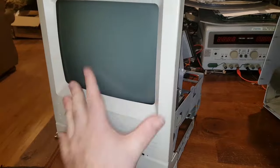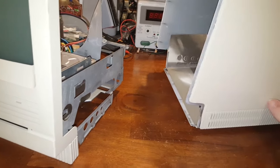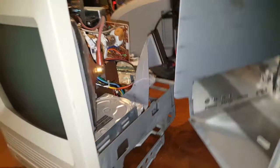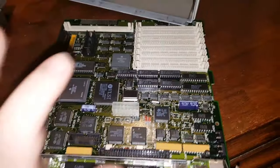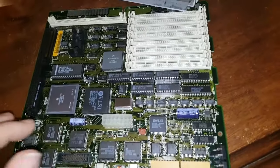I bought it mainly just to get the case, but when I took it apart the logic board had no battery damage. It did not have the Maxell bomb — it actually had a Saft brand battery, white and green, and it wasn't exploded or anything, though the battery is surely long dead since it's from 1989. I took the logic board out, did a quick inspection, and it sat for a couple of weeks. I noticed right away that the UE8 chip was pretty bad, so the first thing I did was remove the battery, and since it hadn't leaked I washed the motherboard in the dishwasher.